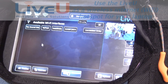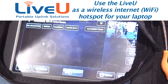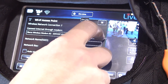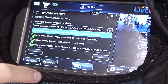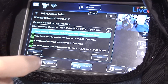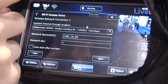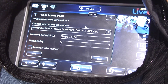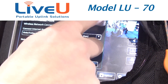Another new feature is an access point. Customers have been asking if they can use the system as a hotspot, and now we can. You click access point, choose which modem to use — after connecting, you'll see bit rates so you can pick the strongest, for example T-Mobile at 800K. You assign a password, hit start, and then on your laptop you'll see an SSID like LU60-1904. Connect to it and it gives you internet. That's a feature that's been requested for a long time.